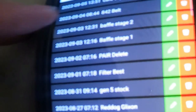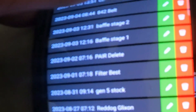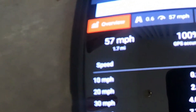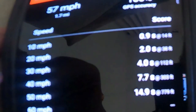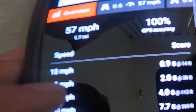I just got back - forgot to record that speed run and had to turn my camera on. But I got it on the timing device: 57 miles an hour - we actually increased by one mile an hour. I told you the air idle screw and needle position shouldn't make a huge top speed difference, but the zero-to-30 got down to 4.0 seconds and the eighth mile down to 13.2, so we did show some improvement.